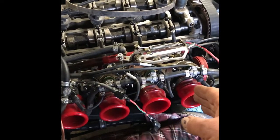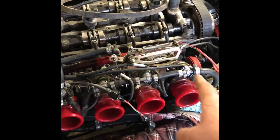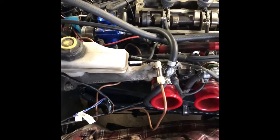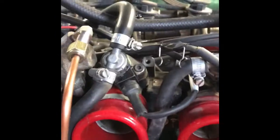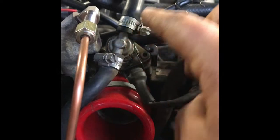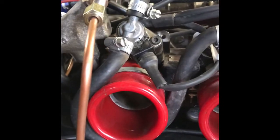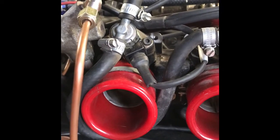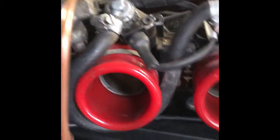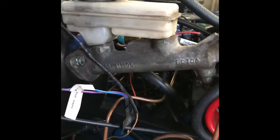I can't come too far forward anyway because there's only about an inch between the end of the trumpet here and the edge of the bonnet - there's a nice big hole cut out for the trumpets. At the moment it's extremely close. Normally the fuel feed for the injectors comes straight through, but this one was so close I've ended up snaking it all the way around, coming through at an angle and then going over to the fuel regulator. It's not ideal and doesn't look good, and I've had an engine get pushed back before, so I need to sort this out.